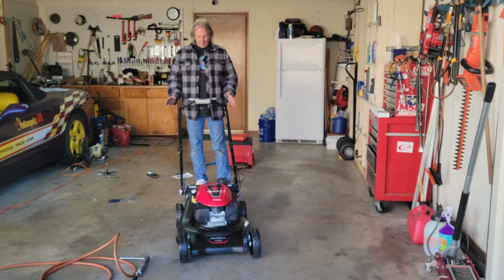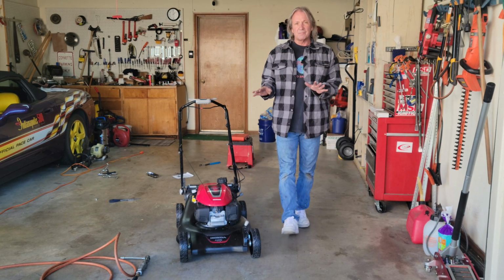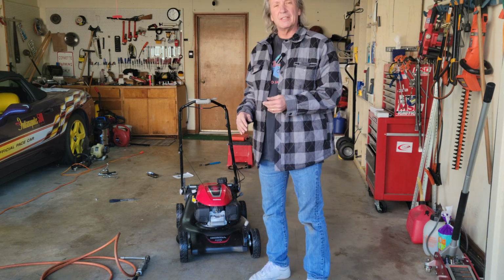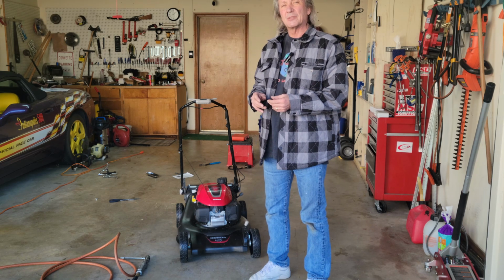We're ready to go. Okay. I picked up this good looking Honda mower pretty cheap. Couldn't figure out why. Had no compression at all. I pulled this apart, did a compression test, and did a quick valve job on it, because valve jobs on these mowers are pretty easy peasy, and realized what was wrong as I was putting it back together.